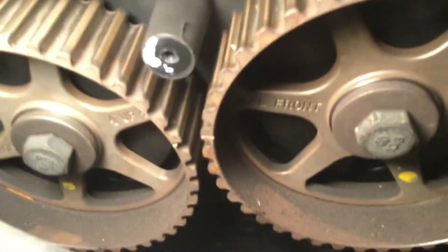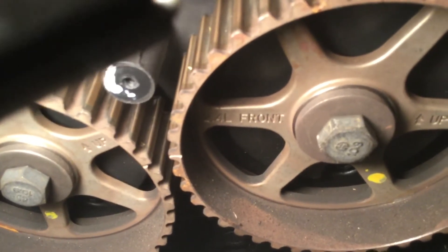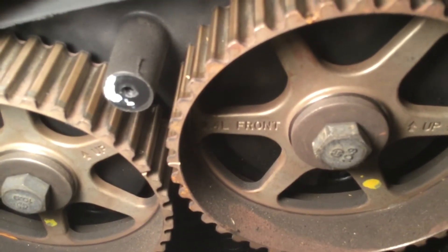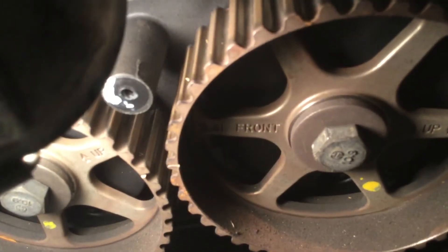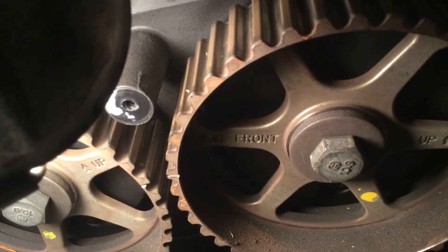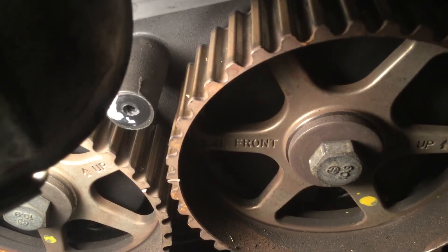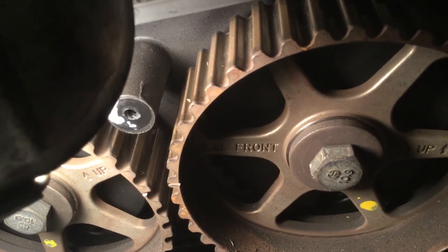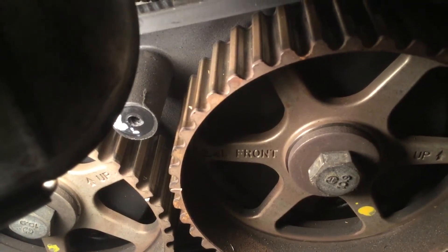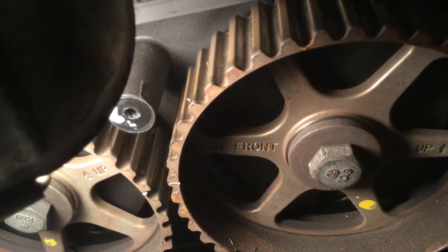You can see the two marks there on the two pulleys that will get lined up. But when you take the timing belt off, there's some tension built up inside of the cam because there's valves and springs. If you don't know exactly what top dead center is — top dead center is when the number one piston is at the uppermost point and the intake and exhaust valves are fully closed. All the rest of the cylinders are in some state of up or down, or valves are opening or closing. So there's some tension built up there, and when you take the timing belt off, the teeth may jump.